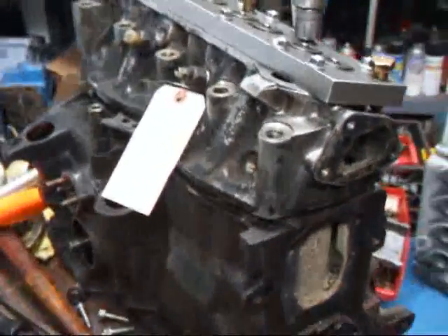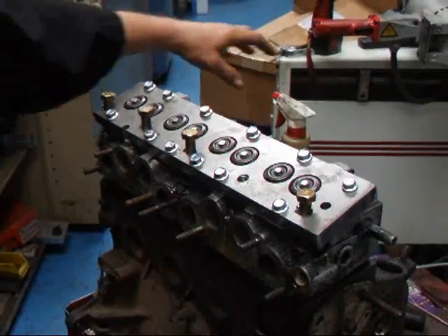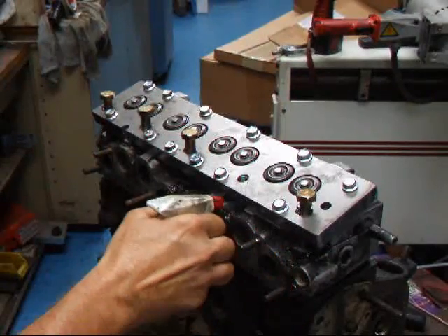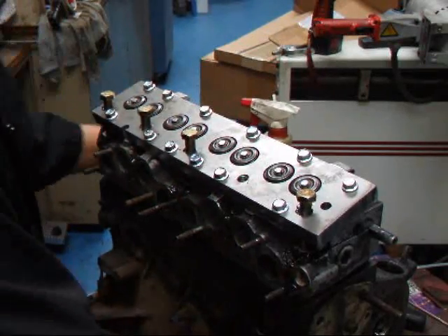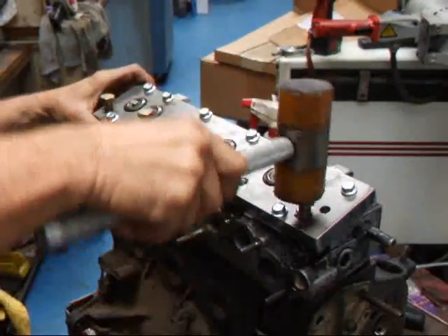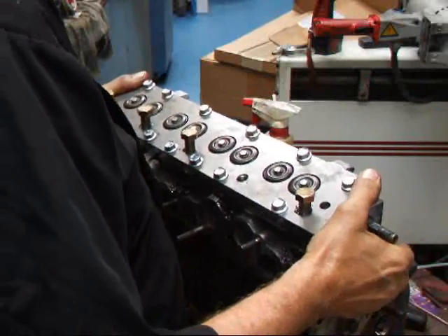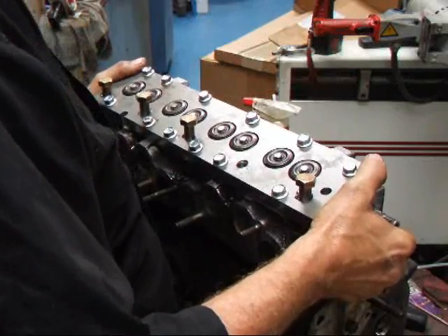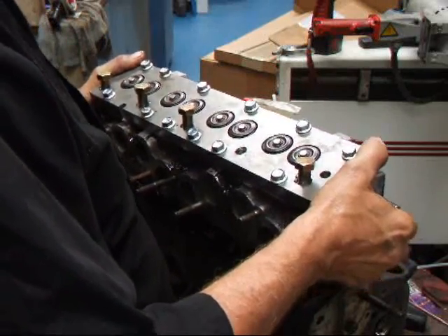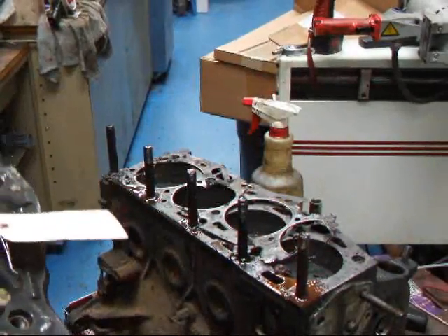As you can see, our head has started to come up off the block, so we'll go ahead and twist this thing the rest of the way off and get it off. I'm going to spray a little bit of penetrating oil in here. We've loosened up the screws, and now we'll see if we can lift this off. We've already tried to get this off with some spreaders and scrapers, and that didn't work so well. But this sure did. As you can see, the gasket's pretty well torn up.